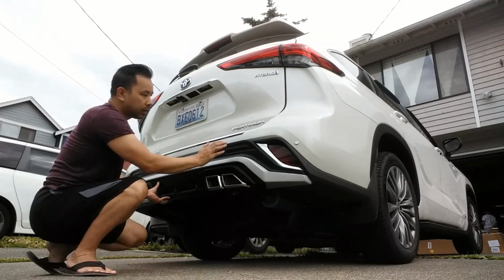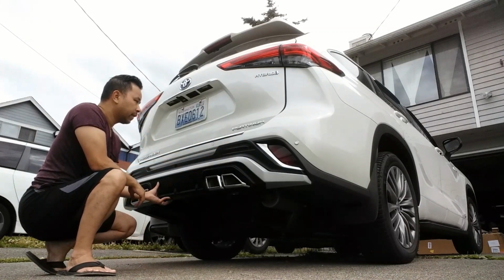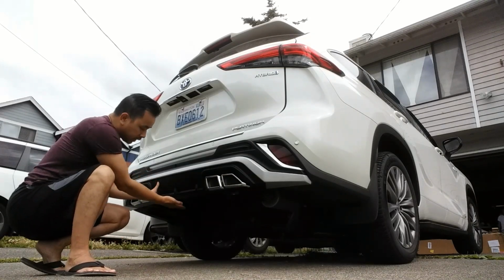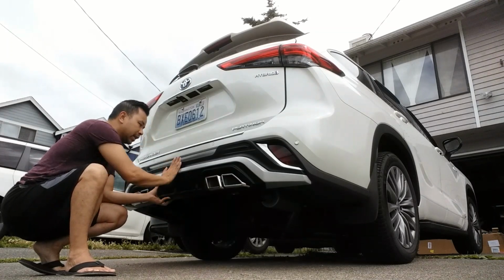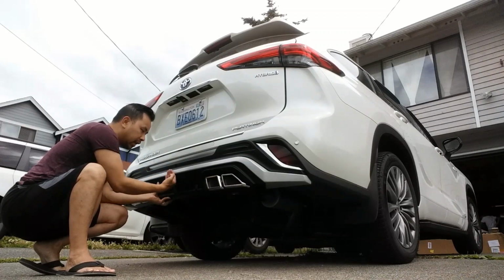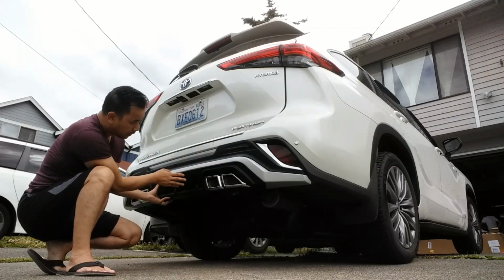But it sticks out a little bit. I know one of the subscribers asked if you did have a U-Haul or a CURT tow hitch that sits down below, will it interfere? I have a feeling because this sticks out a little bit further, maybe an inch and a half, you have to check the clearance to see if it clears here, because it definitely sticks out a little bit more. It's a nice look.